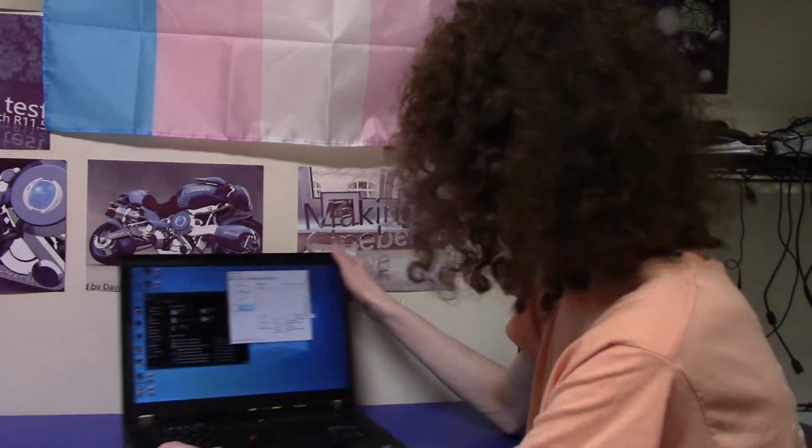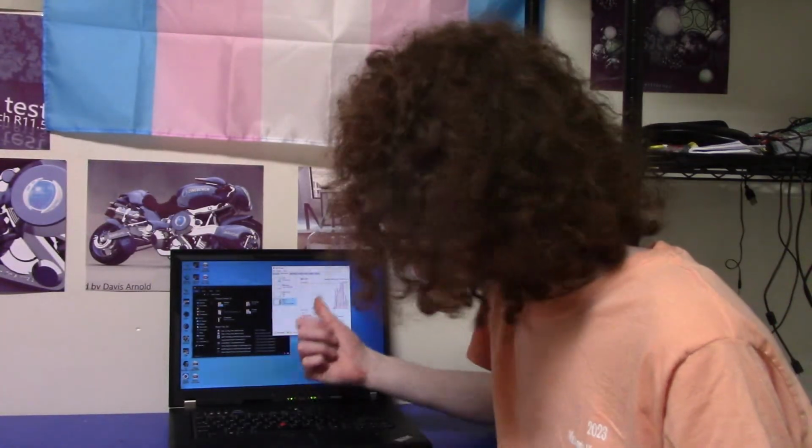As for Wi-Fi hardware, it features the typical Centrino platform Intel 5100 AGN, so it'll perform like pretty much every other 5100 AGN laptop out there. I have noticed, though, its antennas don't seem to be quite as strong as that of the Latitude E6400, my preferred business laptop of this era. It doesn't seem to get quite the same range nor network speed,